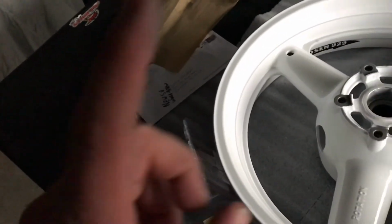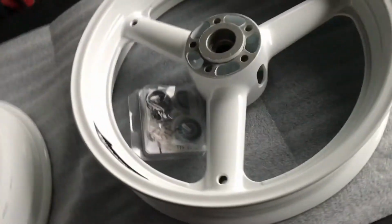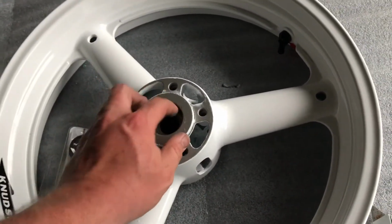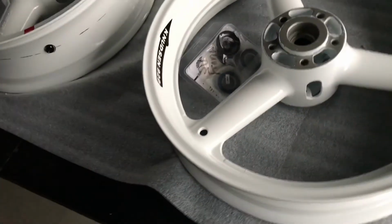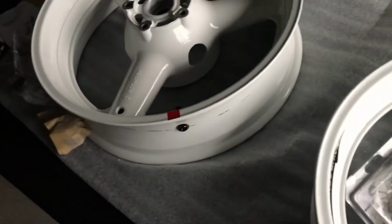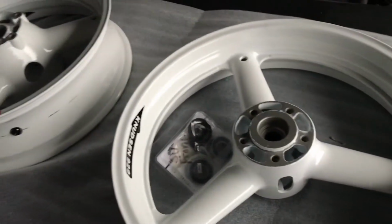But we're going to find our tool, which is, I like using a PVC pipe. It doesn't damage and can really get on the outer race to put it in. Those Motion Pro things are so expensive. Who buys those, really? Probably everybody, and they're probably great, and I should probably invest in them. But here we are, low budget.